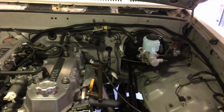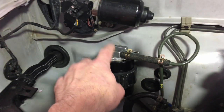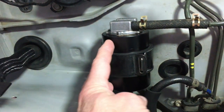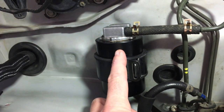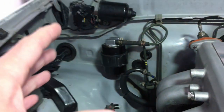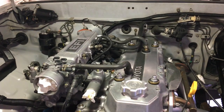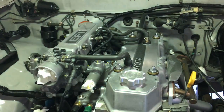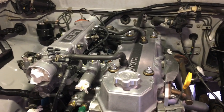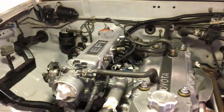I'm pretty happy with how it's turning out. I made my own custom EVAP canister here — I kind of cut the top of the stock canister that came on the truck out, and then I bought this; it's actually like a weed stash container. I cut it and very carefully machined and drilled it. I took the original charcoal out of the Toyota canister, and I don't know if you guys have ever seen that trick where you take the charcoal, put it in a bowl, heat it up with a blowtorch and it burns off all the accumulated fumes from over the years and reactivates the charcoal. So I did that and put the charcoal back in.